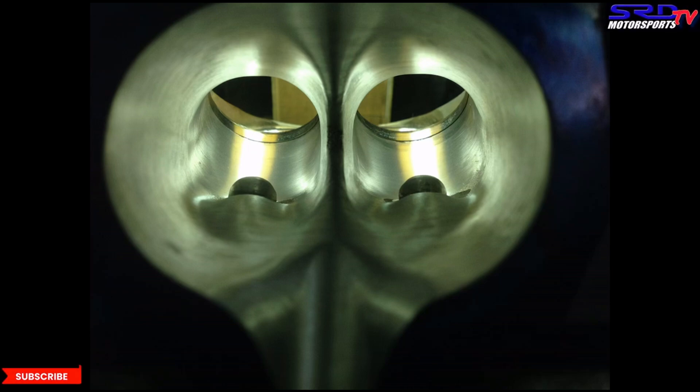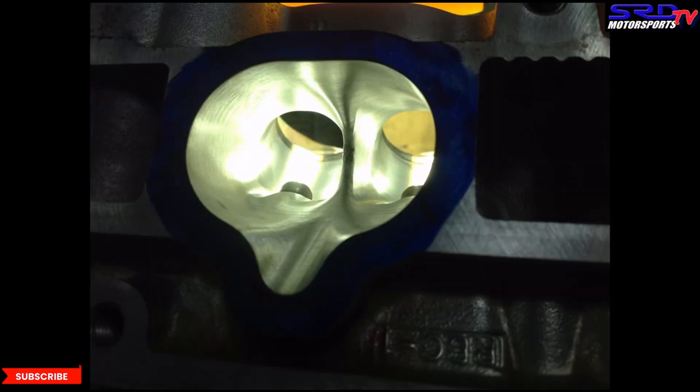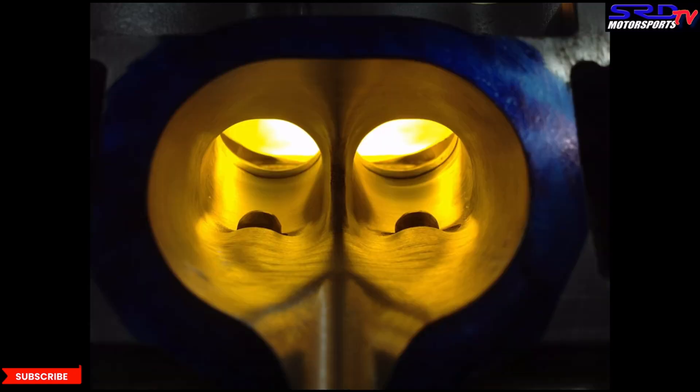We actually used an RBC head. Notice from the bowl it transitions really well into the valve seat. That doesn't mean it has to be this way only for the K-series — it goes for all platforms: D-series, H-series, B-series. You need that transition to be good because when the valve is closed, the flow is stacked there, so when the valve opens you want it to flow really well into the chamber, making the engine more efficient. You can see the bowl and the transition looking really, really good.